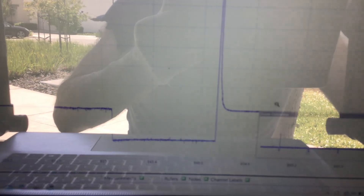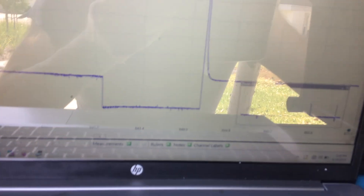The first number on the Power Probe is supply voltage, which is down here on the scope. That looks like about 10.54 volts. We're not going to be dead nuts to the tenth of a number — it's going to be very close. That's our supply voltage. It tells us we got a good feed to the injector, which can come from a relay, an ignition switch, or a PCM control relay. So that does have a piece of diagnostic advantage if we were diagnosing a no start.